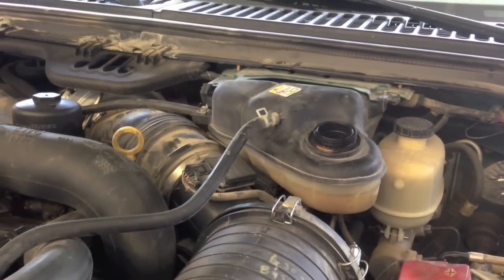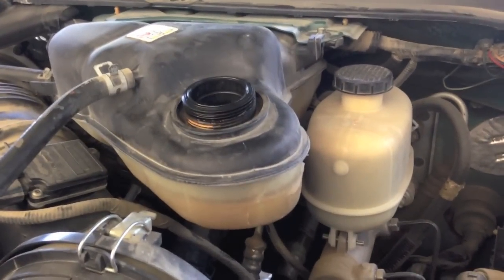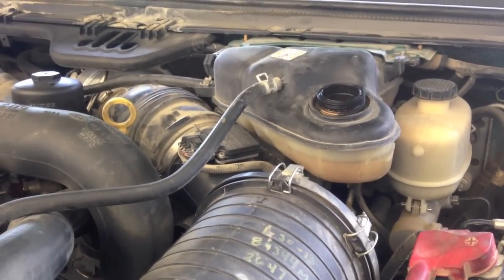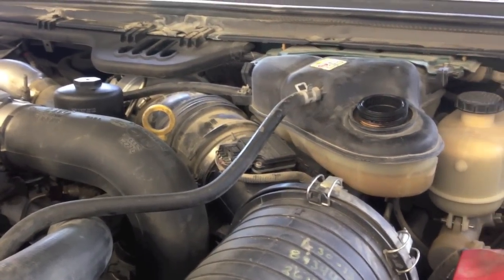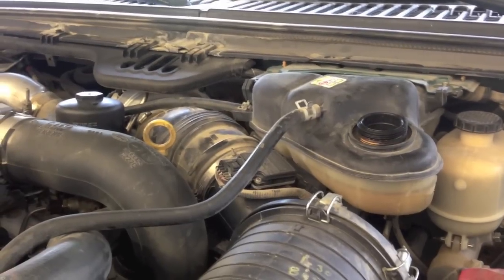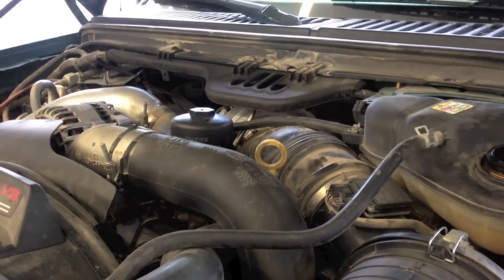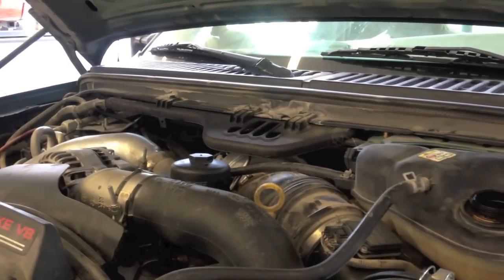Today I have a 6.0 with cracked cylinder heads. It has fuel in the cooling system. What I'm going to try to do is see if I can catch this one. Normally if they're really bad you see a whole lot more fuel inside and I have a video on where you catch them by watching for air bubbles in the fuel line. This one's going to be pretty hard being a smaller leak. This is the construction company's truck that they don't want to stick a lot of money in, so I'm going to try to see if we can catch it here by pulling out each injector and checking it that way. I'll go ahead and drain the coolant and get the injectors out.